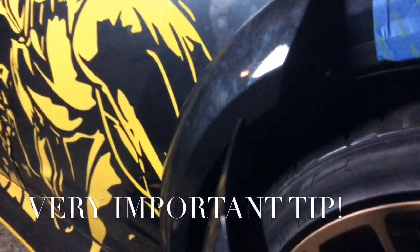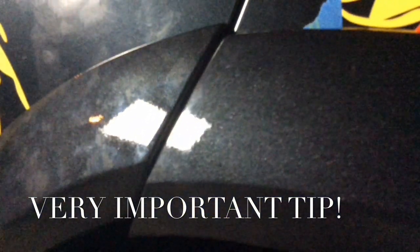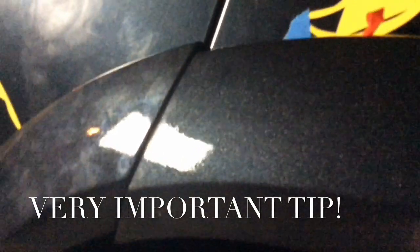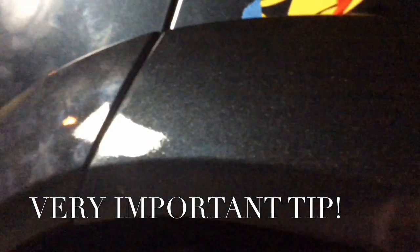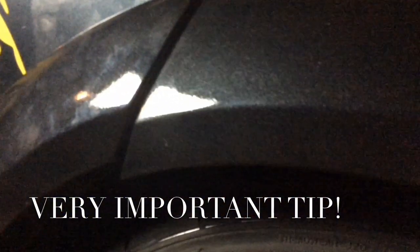All right, so when you're putting on the Widebody kit for the Charger, make sure you put the rear doors on first. Then put on the center ones, because you have to make sure that lines up. If not, you're gonna be slamming this into that and it won't work. You want to make sure everything is lined up so that you can open and close the door. So I'm gonna go ahead and set this on here. I've actually lined up the brackets myself with this temp set on there, but I'm gonna double check by putting this on there.